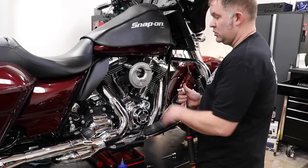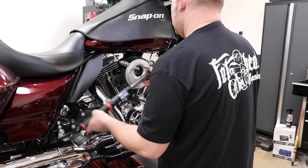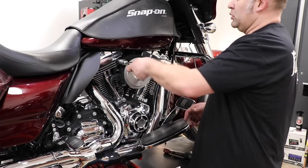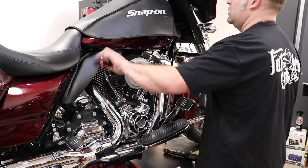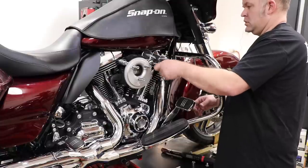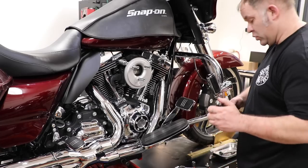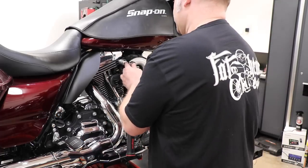We're going to start off with torquing the standoff bolts. Then we're going to take our 1/4-inch Allen and run the breather bolts down, just so they're snug. And then those get torqued to the number that is in your instruction manual.